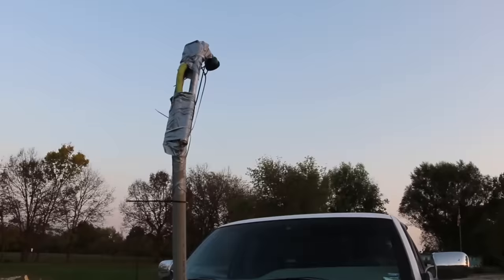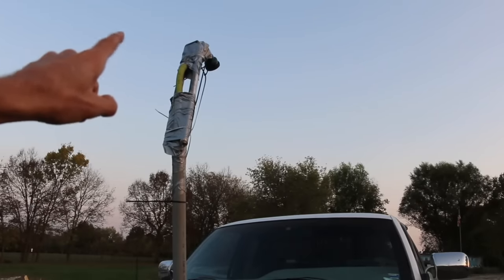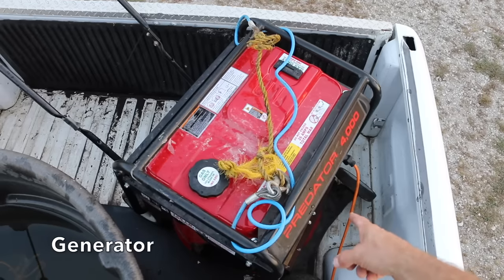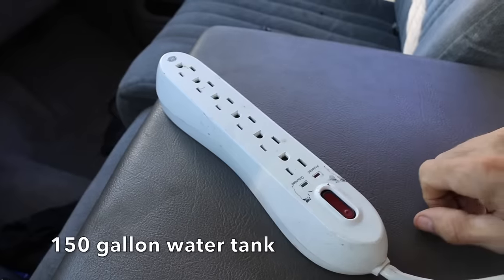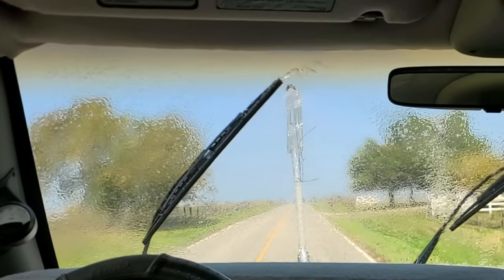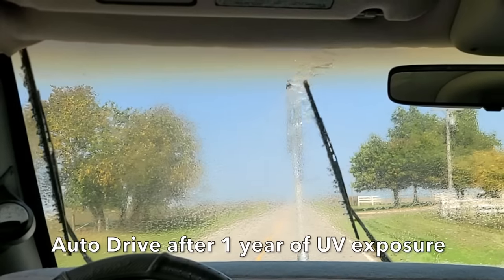To simulate light to moderate rain conditions, I put together a rain simulator on my pickup. There's a spray nozzle aiming down at the front windshield, and the plumbing runs all the way back to the pickup truck bed where there's a generator, a shallow well pump, and a 150-gallon water tank. Instead of waiting for rain, I can just push a button and start the rain. I'll be testing the wipers at 55 miles per hour, beginning with the UV exposed wipers starting with the AutoDrive brand on the driver's side.